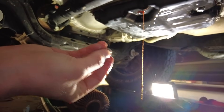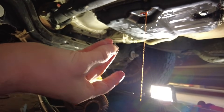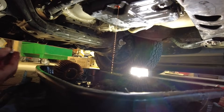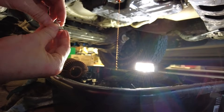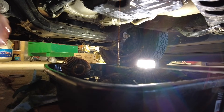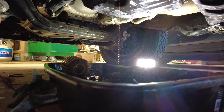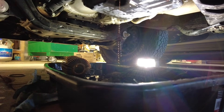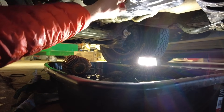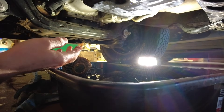After adding more fluid you can see it's spewing out, which is perfect. Once it starts dripping lightly, you know it's full — the D indicator is on your instrument cluster and it's at the right temperature. Once it's just dripping, put the brand new seal on there and install it on the transmission before it gets too hot and loses more fluid. Torque the transmission check plug to spec and you just did a drain and fill on your Toyota Tacoma.